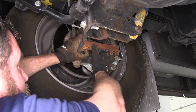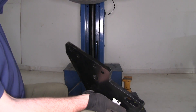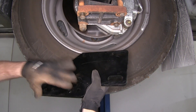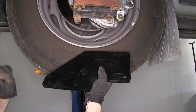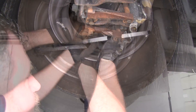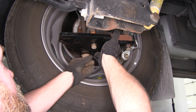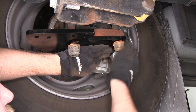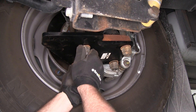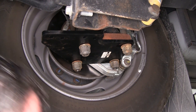Now this plate does come down, so you want to be careful while you're doing this. We're going to go ahead and mount this bracket to the bottom side of our U-bolt plate. We want to make sure we mount our bracket with the holes that we're going to attach our sway bar to, to the front and pointing to the inside of the frame rails. So we're going to orient it like this. Once we have all of our nuts in place, we want to run up our bolts evenly in a criss-cross pattern to set our plate back into place on the axle.